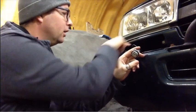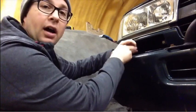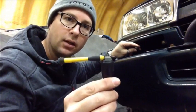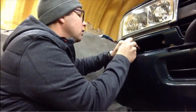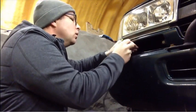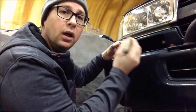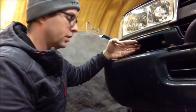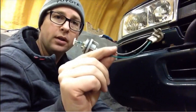So next I'm going to start going back. I'm going to disconnect it back here because I happen to have an extra light connection, and I'm going to see if I have power to flash my test light up here. Because this plug has very small pins and my test light clip is large, I've clipped a small screwdriver onto my ground so I can insert that into the plug on one side, and I'll take the pin from my test light and stick it in the other side. Now if the truck wiring is working, my test light should flash — and it does. So I know that my wiring all the way up to this plug is working properly, which means I've narrowed it down to a problem on this harness extension.